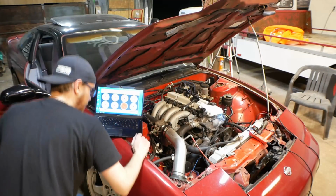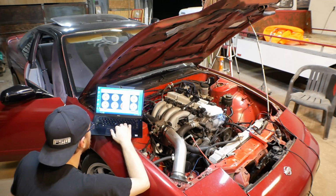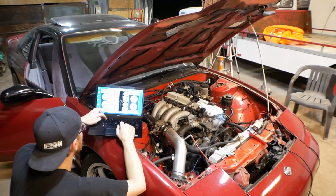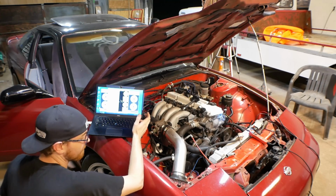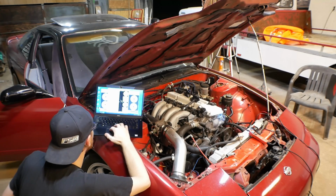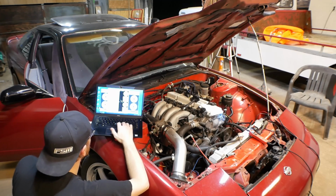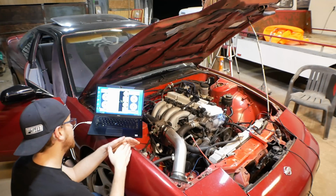So here's where it gets fun, or here's where it gets smoky. We are going to go to advanced and do output test mode, and in here what I'm going to do is 1, 2, 3, 4, 5, hit tab, and that will basically enable the test mode as soon as I hit burn, which I will do now. We have everything off, and yes, everything is off. Now on the test modes here, we currently are in no test mode. If we go to coils, that's going to basically give us a test mode for the coil that I currently have it set to every 3,000 milliseconds, every 3 seconds basically.